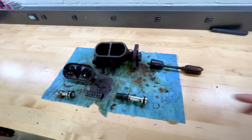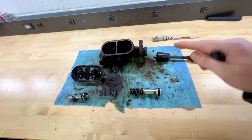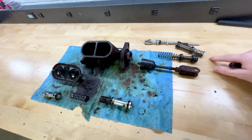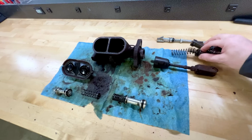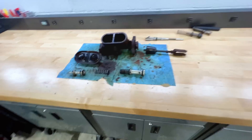As for the fate of this master cylinder, I'm going to try to save it. I've got a wheel cylinder hone — I'll hone out that bore and try to get everything cleaned up. I got new sets of pistons and seals for about $20, so I'm going to get it back together and see if we can save this one and get it going back in the car for 20 bucks and a little bit of time.